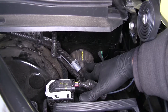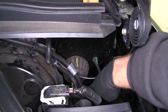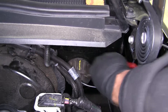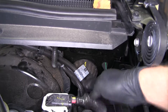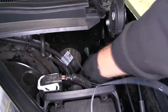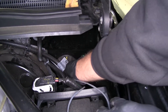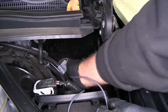Right down here in front of the driver's side on the firewall you've got this large grommet where your large wire loom passes through, and you'll see that little round portion on top. If we cut that we can pass our wire right through there to get to the inside. With that cut off it gives us a nice hole to pass through — just take the end of the wire and start running it on through. If you're going to do a braking system too, that's a good access point. If not, just use some silicone sealant and seal it up when you're done.